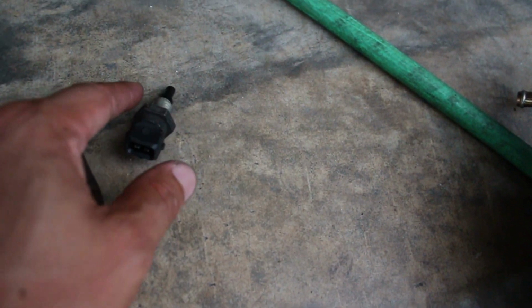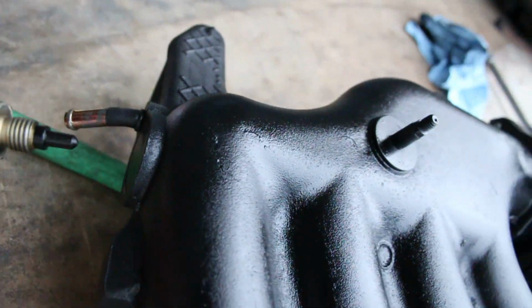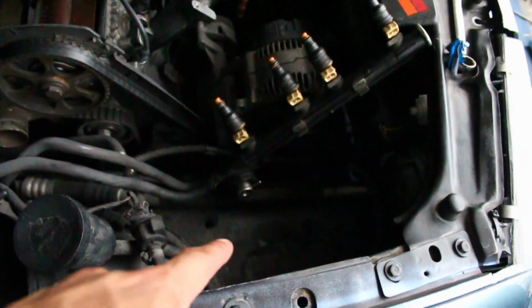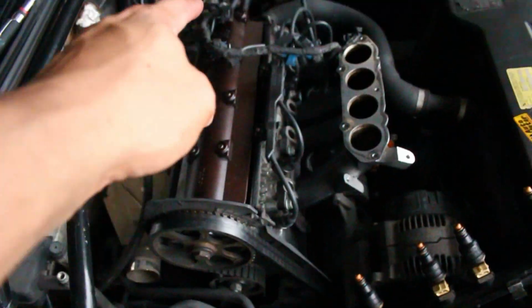And then this is a sensor out of the Mk3 2.0. I take that out with a three quarters wrench to pull it out. I have to drill a hole through this side piece right here and then have that mounted in. If I can get the thread right back in, then that'll be good. And then I still have to extend the MAF wire somewhere in here, right? I lost it, it's in there somewhere. I have to extend the MAF wire from the MAF sensor. Oh, here it is. Extend this from this side where it usually plugs in to that side where it's gonna be now.